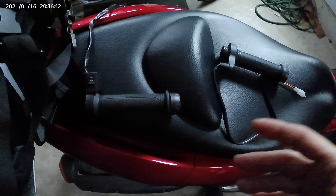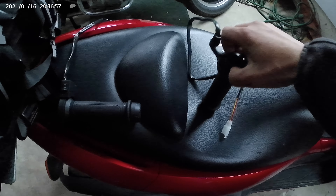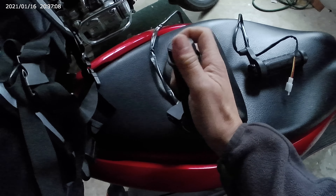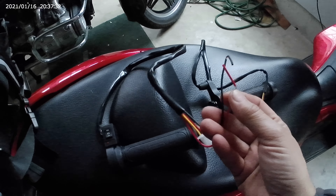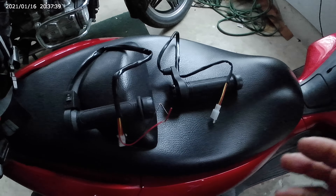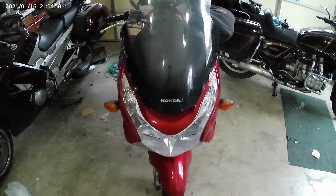I don't know anything about the reliability of these, but this one is the throttle side because it has this position here. This little piece of plastic just kind of comes out, and it does have these really ultra-cheap bar end caps, but I'll probably be putting my regular bar ends on. You can tie this directly to your battery and it will power up, but if you've installed heated grips they will zap your battery very quickly if you leave them on, so it's best to tie it into the existing wiring for the bike, which is what I intend on doing.